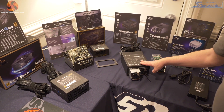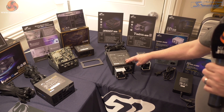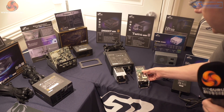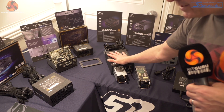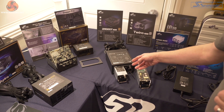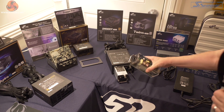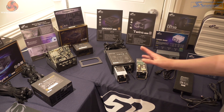This is the Twins power supply. This is controversial in the sense that I personally am not mad keen on it — or not fussed, more accurately. Luke loves the idea of Twins. It is two power supplies. That is a power supply in a Perspex case — you can see it. Each is rated at 900 watts and the second unit is for redundancy; that's the primary purpose. So if it's in an ATX case and one of the units fails, the other kicks in. In the event that one is overloaded but not actually broken, the other unit can kick in to help. It's for very particular sectors, particularly workstation use.